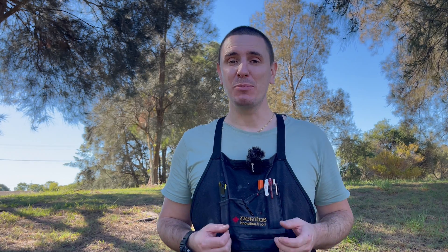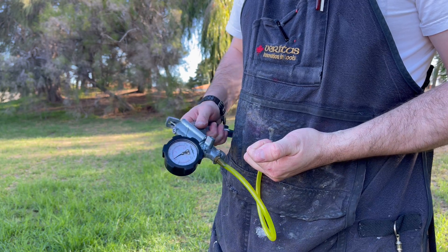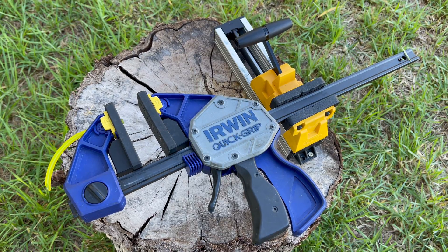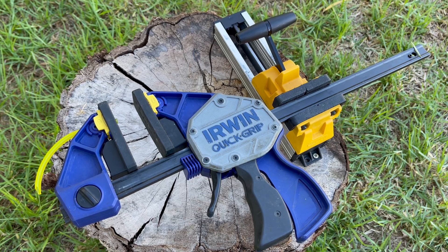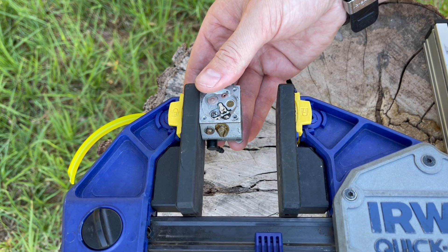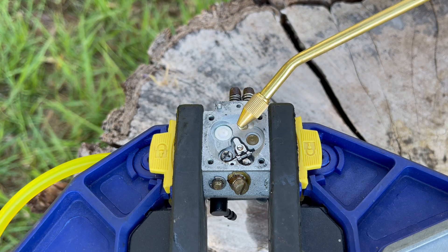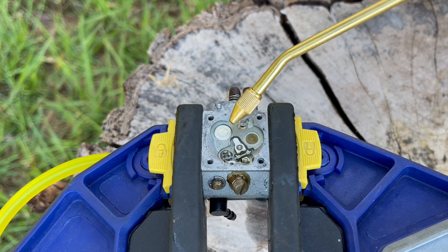To pressurize the carburetor I'm going to use a hand pump. I'll put a link in the description for the one I'm using here as well as a more affordable alternative. To make this process a little easier I'm going to hold this clamp in a vice, and we first want to fill up that metering chamber with some fuel. It's important that we do use fuel and not substitute any type of oil, because that can actually seal up possible leaks temporarily and give you a false reading.